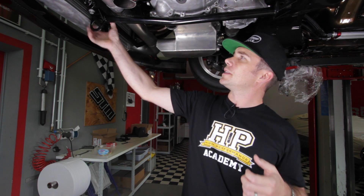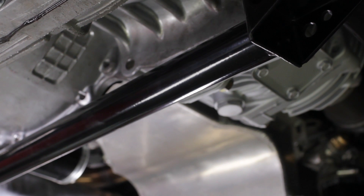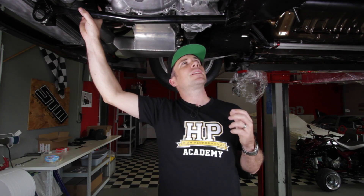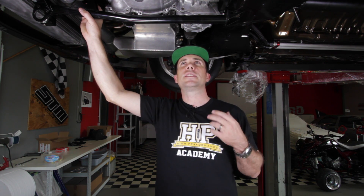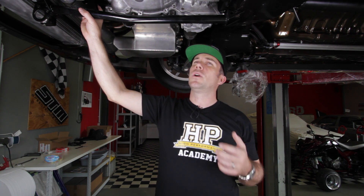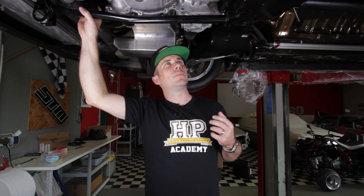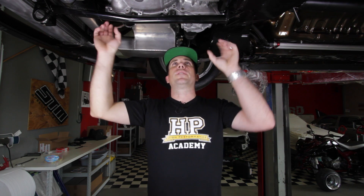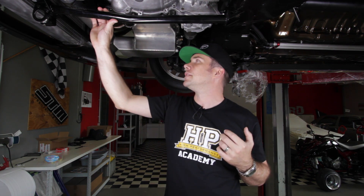Just back from that you can see this north-south cross member that Paul's made up here. It's made out of chromoly and this is the main north-south cross member that holds the engine and the gearbox. The factory cross member is quite heavy and one of the most common maintenance jobs on these cars is pulling the gearbox in and out — either to inspect gearbox components or to inspect or replace the clutch plates. This cross member is a lot narrower, it makes it a lot easier to drop the gearbox out, and it saves about 6 to 8 kg.